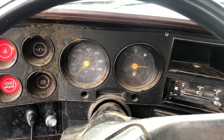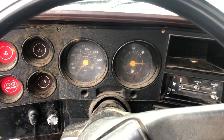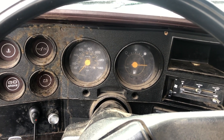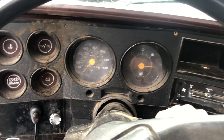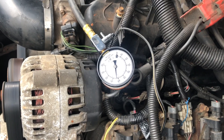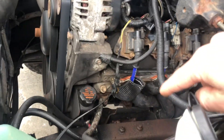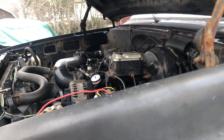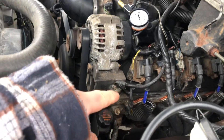My coolant sensor is now bad too. We've got a little over 60 pounds of pressure, but this thing's running like a bag because that sensor decided to quit — it's showing the computer that it's minus 40 degrees. We'll have to get a new sensor to sort that out. The pressure is slightly higher than before, but that's to be expected with a higher-flow pump. The truck's not even warmed up yet and the fans are already running. We're going to get another video on diagnosing that coolant sensor.